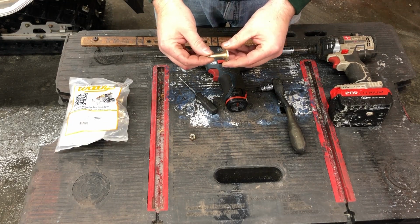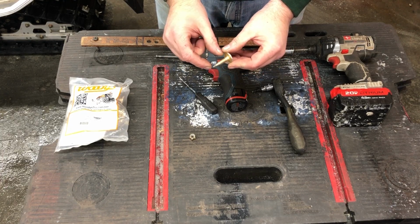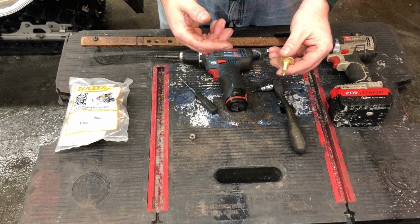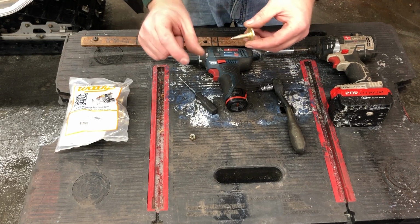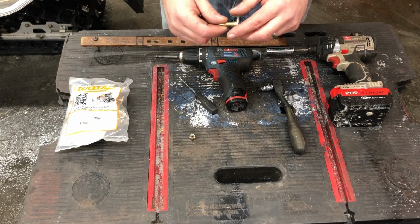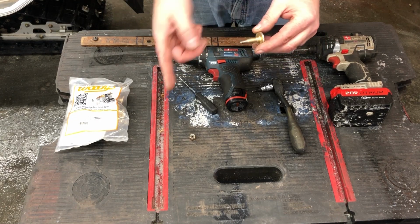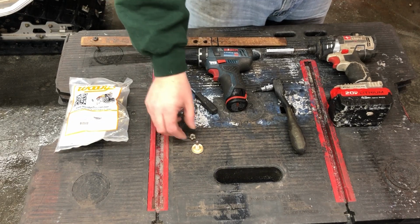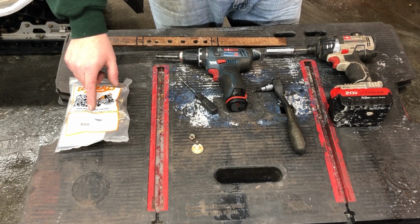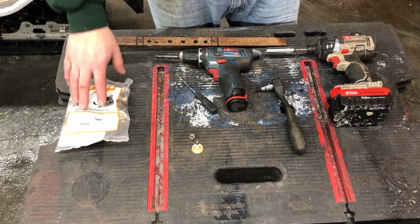As far as the length of these studs, from the shoulder to the tip of the carbide, it's roughly 1 1/16 inches. So when you install it, because the lug of the track is 900 thousandths deep, you're getting a 1/4 inch of penetration, which is what Woody's, Stud Boy, and Max studs pretty much recommend. You always want a 1/4 inch of penetration over the top of the lug. So that's what we ended up with. The part number on this is GDP6-1005. You can look at it on Woody's site to check out the specs on your own.